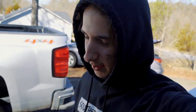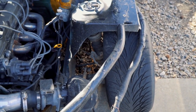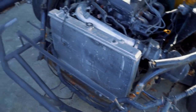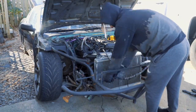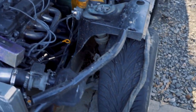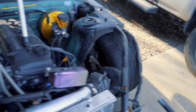Picking up the next day — right now I'm going to start delooming everything right here and then I can start looking at how I'm going to fish things through. I'll probably start pulling a little bit of the interior part just so everything slides through easily. I've got a good bit of it deloomed now — I didn't take all the electrical tape off, just the main plastic loom, because I'm going to put some new fresh wire loom on there.